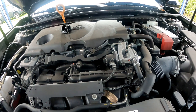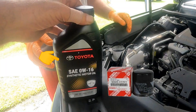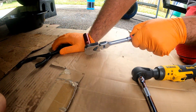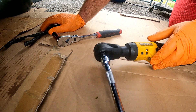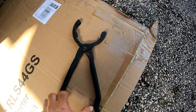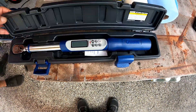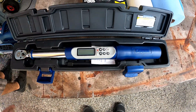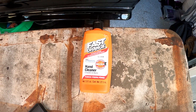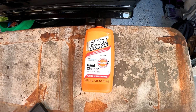So let's go over the tools and parts needed. We'll need 4.80 quarts of 0W-16 full synthetic oil, an oil filter, oil pan and funnel, a 10 millimeter socket for the plastic pan cover, a 14 millimeter socket for the oil drain plug, an oil filter adjustable plier, a torque wrench for the oil plug, mechanics gloves, and some hand cleaner. Check the description for all the links to these parts and tools.